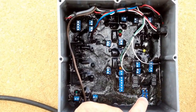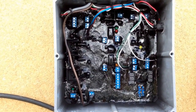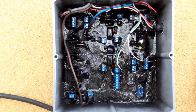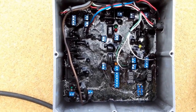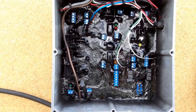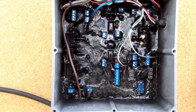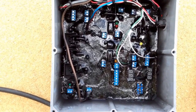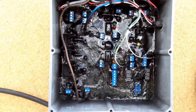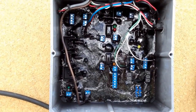There is also a frequency adjustment I forgot to mention. Just some engines like a different frequency than others — some like a slower frequency feed, some like a really high one. It's one of those things you don't have to worry about once you set it. Most people leave it at the recommended setting as shipped. But for some engines it's a needed adjustment — some like a higher frequency, some like a lower. So those are the four adjustments.